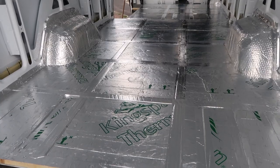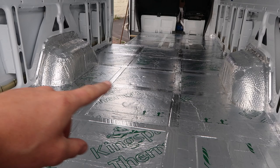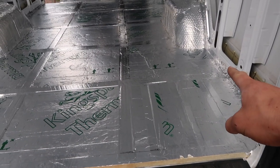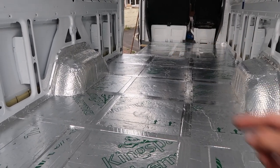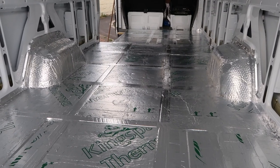I've just finished the floor insulation. As you can see, the wheel arches are insulated, and I came around the side with foil tape just to connect with the wall so it's all one sealed floor. Next job is to get the floor back in. So that was the battens and the insulation put down. Next video will be putting the old flooring back down and topping that with some 6mm ply, so have a look at that one — I'll see you next time, cheers.